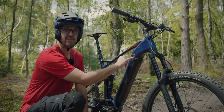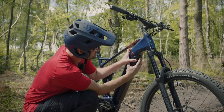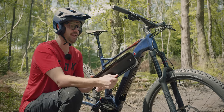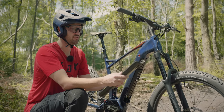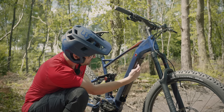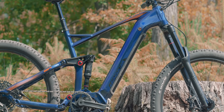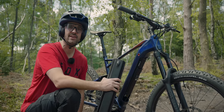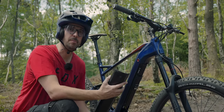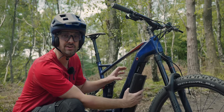The battery is fully integrated and locks in with a key. I'm not a big fan of keys, but loads of e-bikes use them. There's a button underneath — you just pull down — and like many e-bikes it's got a little rubber-sided plate to stop vibrations. You can see the Bosch PowerTube Intube battery; this is the PowerTube 500, and there is space for a 625 watt hour battery in there — official from Decathlon, they've confirmed you can fit one. To get the battery in and out is really simple: no Allen keys or bolts, just pull the lever down — no tools — then use the key to remove the battery and charge it indoors.